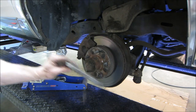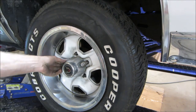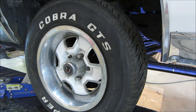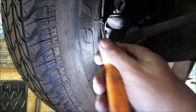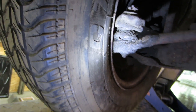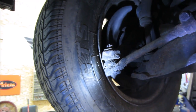Wheel spacers. What's up with that? I wonder if the rim hits the caliper. I'm gonna try putting it on without it, see how it does. It's like it clears everything. I'll leave those spacers out of there. The lower tie rod looks close, but yeah, that's probably what we're going for. Yeah, there's an air gap there. I'm gonna try without it. If we hear some scraping, maybe that's why they did it. But they generally do not help front end issues at all.